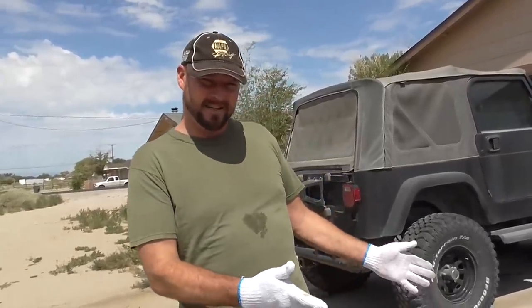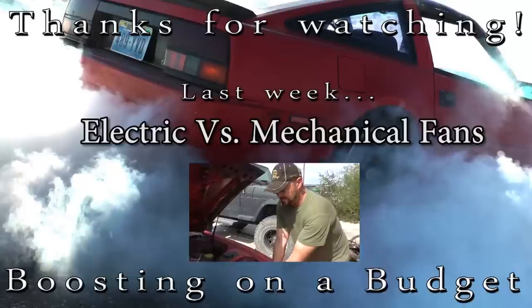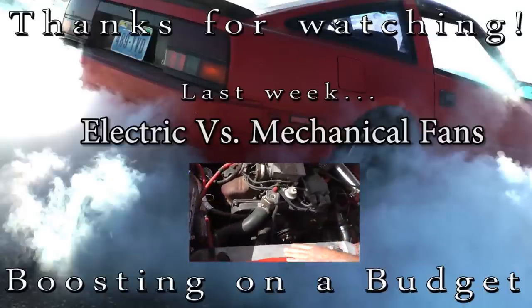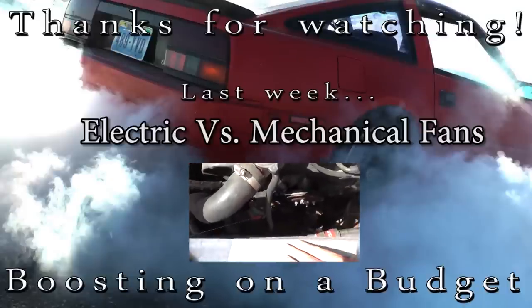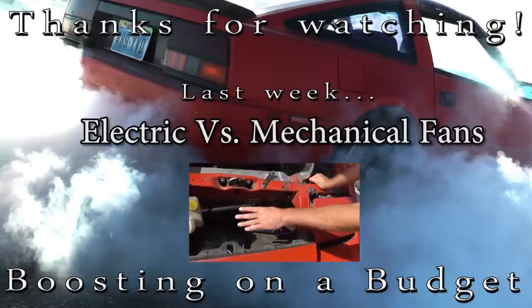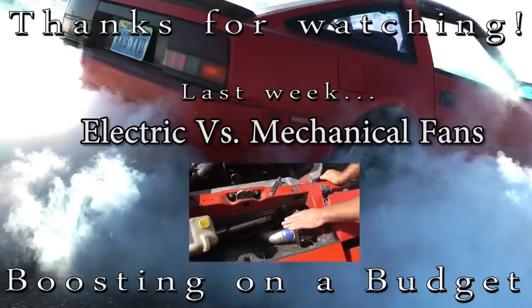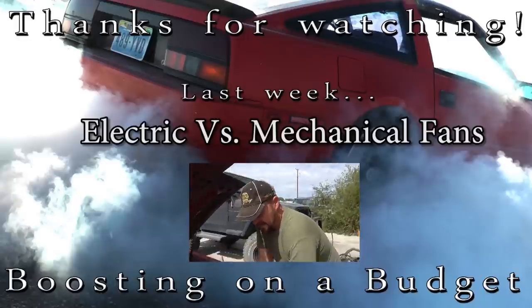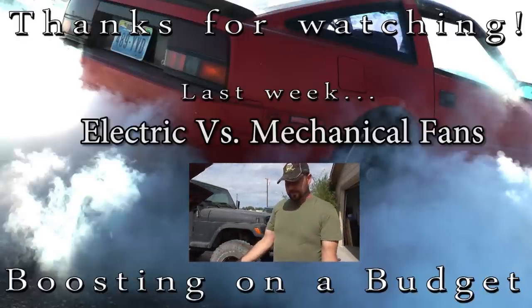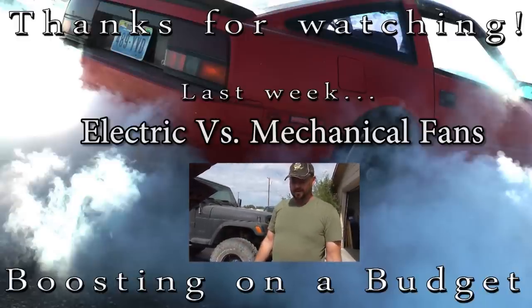Remember, knowledge is power — it's horsepower. Ever since I converted to an electric fan, look how clean everything is. I had room for my intercooler right here and room for my intake right here, because before there was only this much room and that's where the factory air cleaner was. Look at how clean it is — there's just so much room now that I put the electric fan on here.